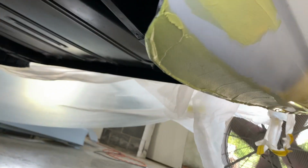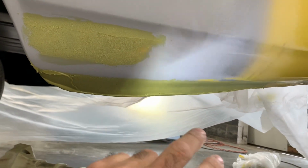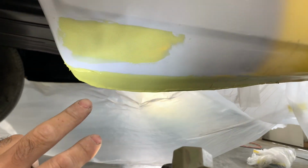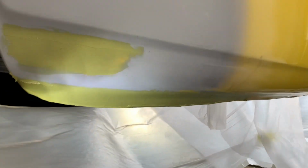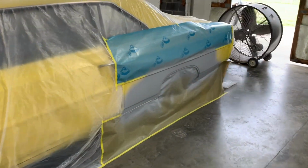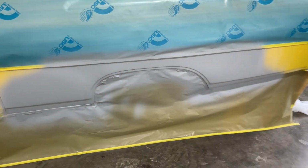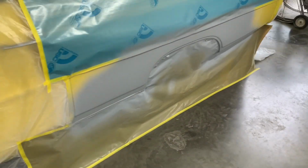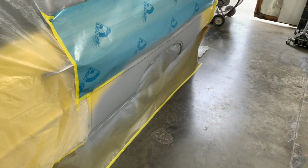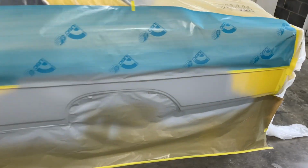Working on the outside now, where I burnt the paint and the filler that was on the outside, welding it. I grinded it down, smoothed it out, swiped a little bit of filler in there now, and gonna block it down and put another coat of primer on everything. And got more primer on the quarter panel. So I don't know, I'll see how it does when I block it this next time. I may put another coat of primer on it, or I may just let it ride.